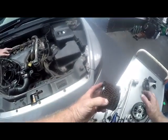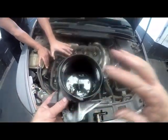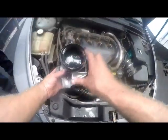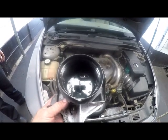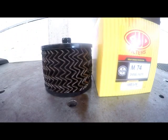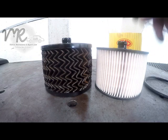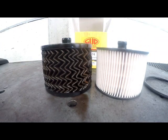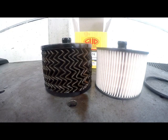We're putting in a new filter. A tip: I normally take out the whole unit once it's loosened and go wash everything out before putting everything back. Remember to keep the filter in place and loosen up the top first, otherwise you're going to have a hard time. Here we have the difference between the new and the old filter. The new filter comes with its own seal — that is what the new filter looks like, and that is what the old filter looks like. It's been long overdue for a change. It looks like this could be the problem for this vehicle losing power periodically.